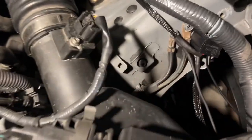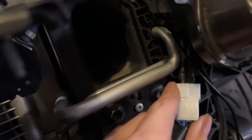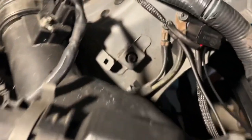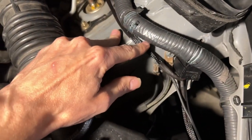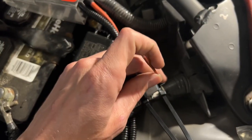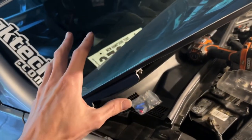Pretty much everything is wired up. I've got the power wire connected to the positive terminal, the ground connected right to the chassis ground, and a power wire going to the battery - everything's spliced in and good to go. I still have to run the switch wire into the cabin, get a switch put in there, ground the switch, and find an ignition-on source for that wire.